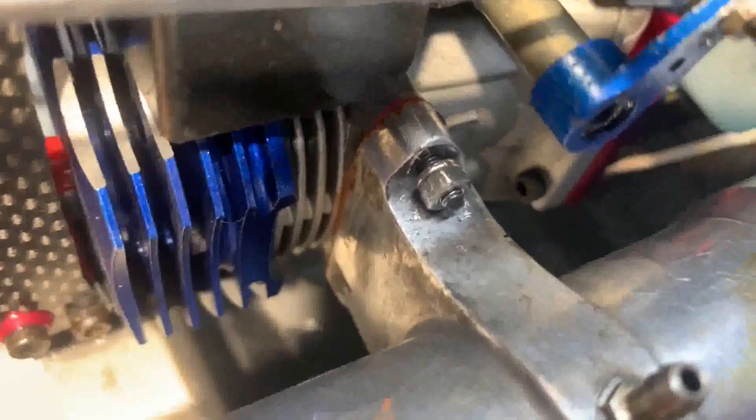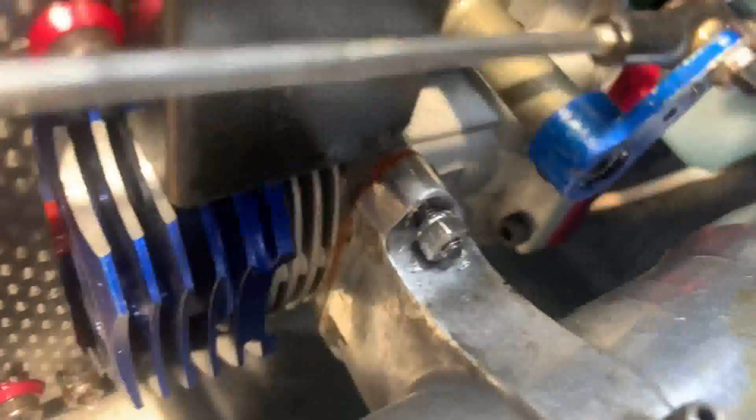Both screws on — was able to grab a little bit of thread so it held pretty tight. I like to put a nylon bolt on the other side and put it on backwards so that it mates with the pipe a little bit better. Once it gets up close, with it reversed it fits pretty well. You don't want to use Loctite on this.